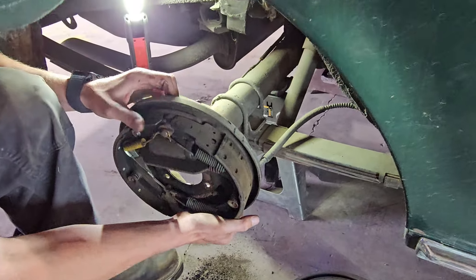We're going to start installing the brake lines on our rear brakes. This one comes with a banjo fitting, so we'll tighten that down. I already have one side in and eyeballed where we're going to need to weld our brackets. Throughout this whole process we've been having to bend these brake lines around to get the right angles. We'll weld these brackets onto the axle to hold our brake line on both sides. The banjo fitting has a hole that transfers fluid from your line — just make sure you have a copper crush washer between both pieces. The brake line goes up to the bracket we welded onto the axle, then tighten down the metal brake line into the fitting. Put in your clip.